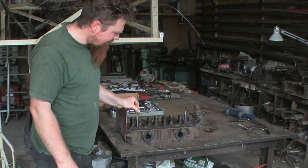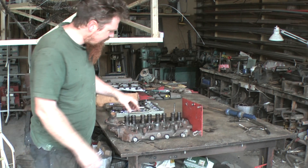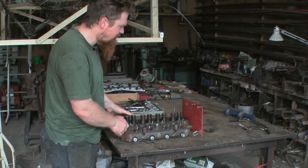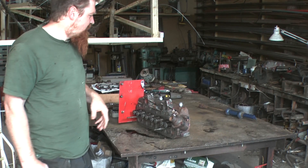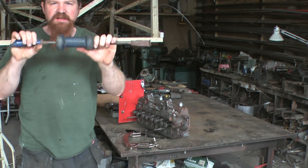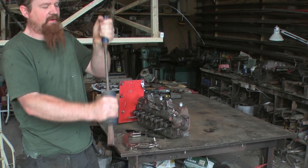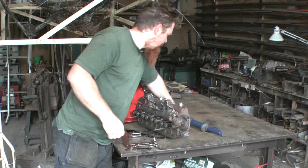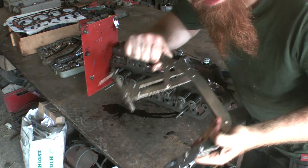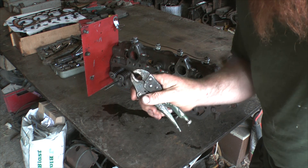Here we are back in the workshop with the cylinder head on the bench, which makes life a bit easier. I'm going to strip this down, get all these components out, have a look at them and see if they're all serviceable. I think they are — it's actually looking alright, this bit. So far I've needed two special tools: this is one, the valve spring compressor, and the other one, for removing the injectors, you'll generally need a slide hammer. So once you've undone the injectors, you hook this bit over it and give it a good whack. They'll generally pop off. Both of those are quite hard to substitute for, so worth having.